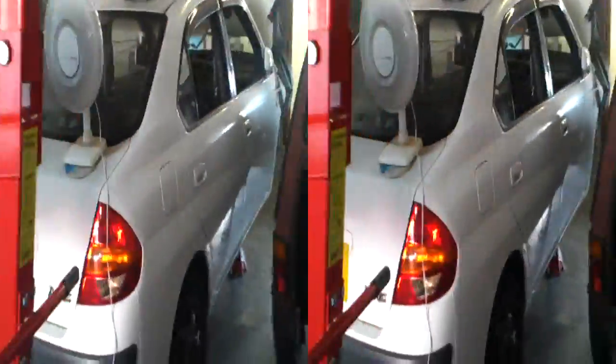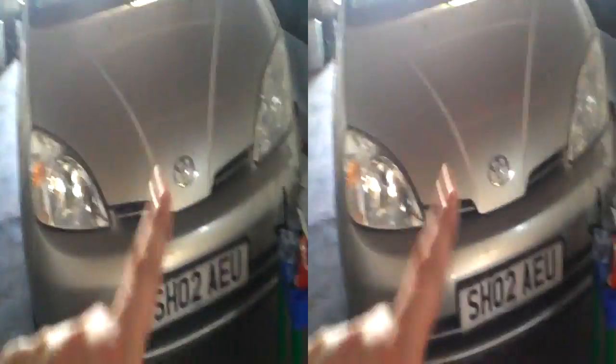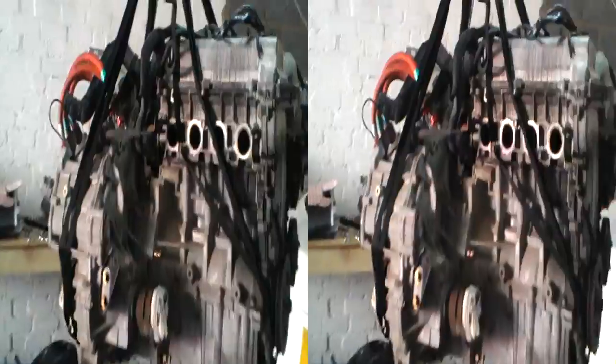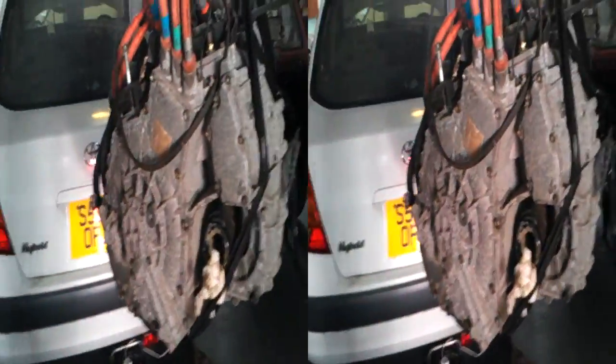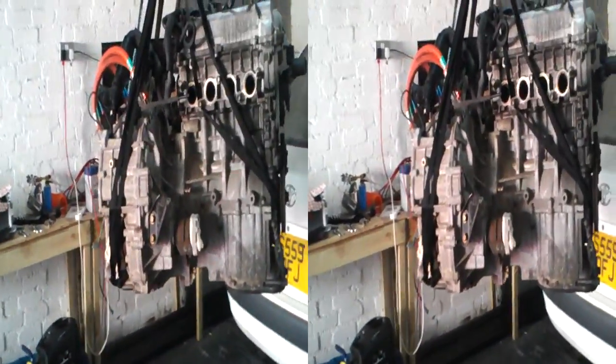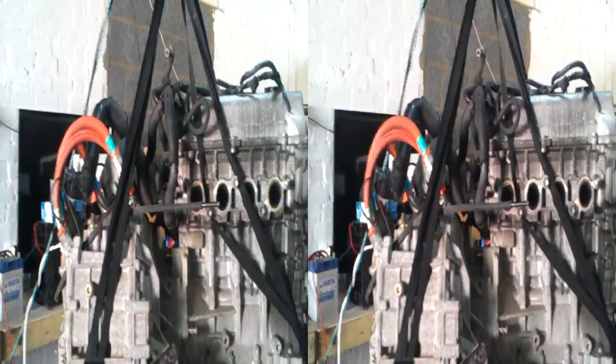This is off an NHW10. The actual engine in there is the same engine, and the transaxle is the same in overall operation - it's just got bigger. There's a bigger motor for the power, for the drive, and there's a bigger generator - that's the difference. In the next generation up, it's bigger still. I think it may well be the same castings; they just put bigger internal components. Should be interesting.